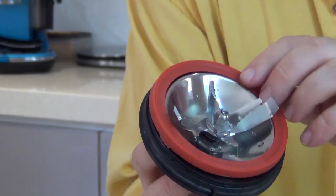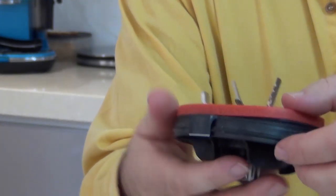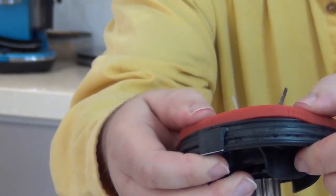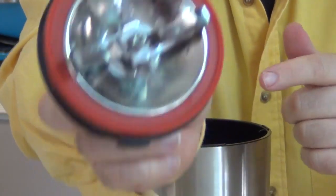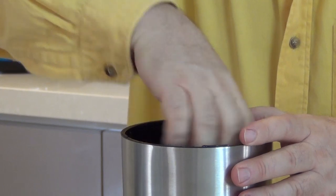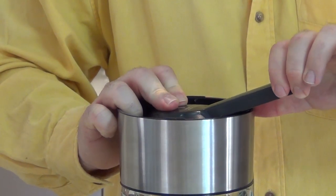Here's a little tip: when I was putting the rubber seal back on and tightening it, it was leaking and I couldn't work out why. You've actually got to push this red band all the way around so it seals snugly before you screw it in - then the red seal will stay nice and tight. You line up the two little notches with the slots in the bottom of the base, turn it anti-clockwise, and tighten it up. This tool here fits a couple of guides to let you tighten it slightly - just don't over-tighten it.